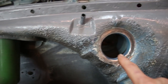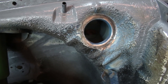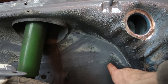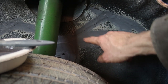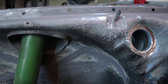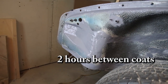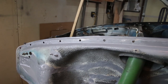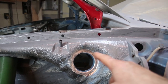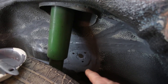I found another hole right here which I'm going to weld a plate over because I'm not using the factory fuel filler. I just touched up this area and tried to feather the undercoating a little bit with my DA sander so I have a better chance of blending it in — no more bare metal showing in this section. I've got two coats now on the front bumper bracket area, and I'll come back with at least another one or two coats on these rails to make sure they're fully rust-proof. Then I'm going to weld this and put some more epoxy primer over that, and also put the brake tab back on those pieces.